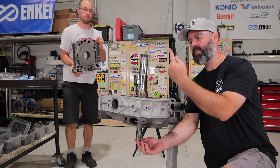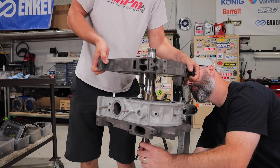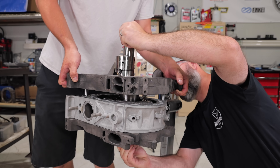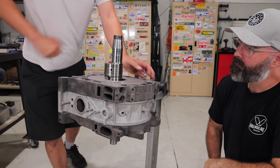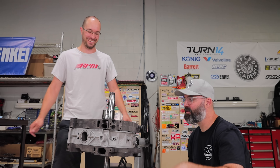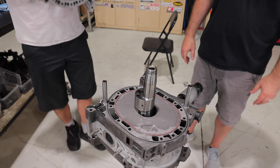Now it's time to put the next iron in place. Joe has to lift the eccentric shaft up a bit from below so it can hook over the journal area on the shaft, then lower the iron down and line it up with the dowels. If a corner seal falls out, you generally hear a little ping — sometimes they fall inside the rotor housing and you've got to dig it out with a magnet or take it apart again. As we continue to build the stack, the process is pretty much the same: Joe puts in the two coolant seals, throws the dowels in, applies RTV to seal the oil pan area, and the next housing goes in.